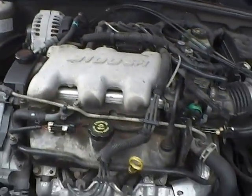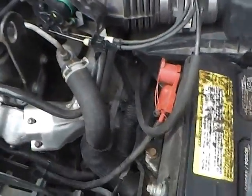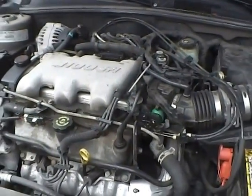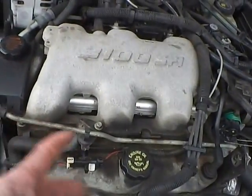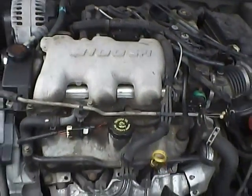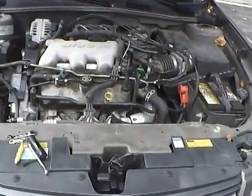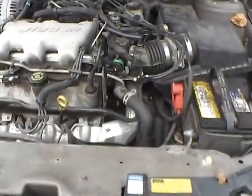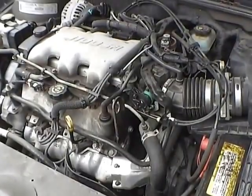Anyway, this has now gone over six months and there's only just a tiny bit of a leak there. Rather than pay somebody 800 bucks I tried to do it myself. I found this tip on eBay — somebody had the new gasket set ready but found the bolts were loose, tightened them down without replacing the gasket, and bought themselves some time. This car only had 22,000 miles when we got it three years ago and it's a 2001 — it now has 80,000 miles and we haven't had to deal with the gasket yet, which is great. Thank you for watching and I hope this helps somebody.